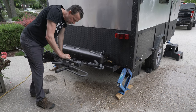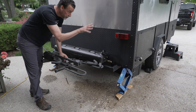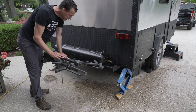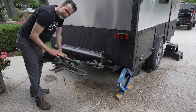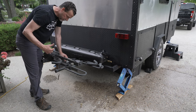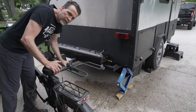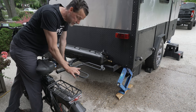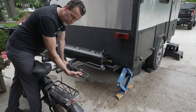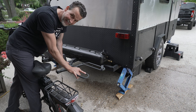This is my heavy-duty bike rack — with the adapter it can carry up to four bikes, though I'd never carry four. Just for example purposes, I'm going to load up my e-bike to see how that affects tongue weight. Like a lever, the further away from the axle you go, the more the weight affects tongue weight. The e-bike weighs about 70 pounds and we've come out almost two to three feet. Note: this carrier is meant for mountain bikes with 29-inch wheels, not fat tires — I'm doing this purely as a demonstration.